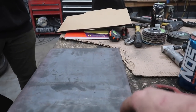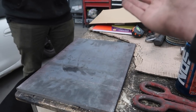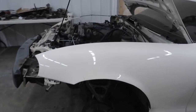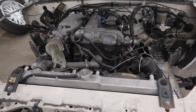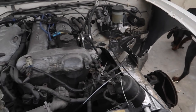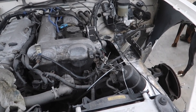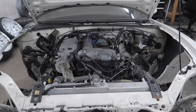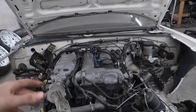I never really had any issues with it, because shortly after I did my skid plate and my engine raise, I ended up going with my bigger wheels, and it basically raised my car. But now because we're doing all this work and cutting it all out, we did test it on the ground. We basically had this thing sitting on the ground on the subframe and the wheels weren't hitting, so we realized we're going to be able to have the frame on the ground and be really low. So obviously we want to protect the oil pan, and we are going to make our quarter inch lift plates.